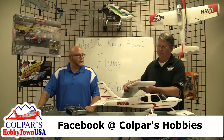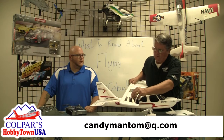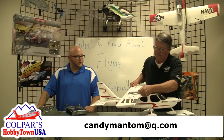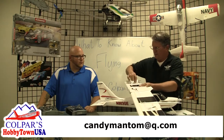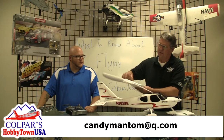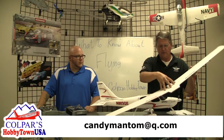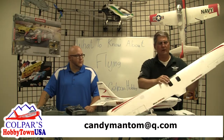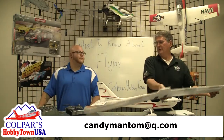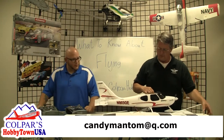So when you get your aircraft, first off, when you're doing your pre-flight, make sure to look at components like the servos are mounted and solid and don't wiggle around. Make sure that you have clips locking down the clevises going to your flight controls on both ailerons. Make sure that your wires are mounted securely for the ailerons as well. And once you've inspected the wing, don't be afraid to check that it has some rigidity, because sometimes if the spars aren't glued in correctly, the wing will flex in flight, and you know what that can end up happening after that. That's pretty ugly. Crash.